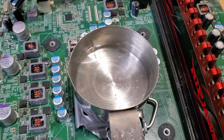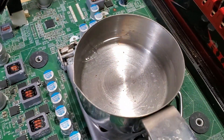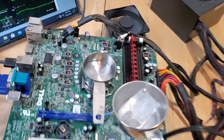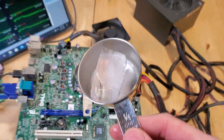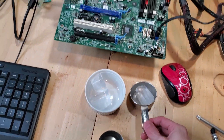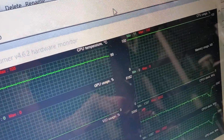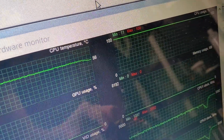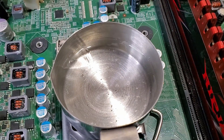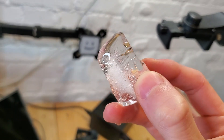After a couple minutes, the ice cube is basically gone altogether. With only a cup of water sitting on top of the processor, the temperature of the CPU slowly starts to climb again. Eventually this water will actually boil away, leaving behind an empty cup. So maybe what we need to do is simply replace the cup of ice every time it melts to sustain reasonable CPU temperatures — that's what they do in Futurama to keep the earth nice and cool. Grabbing a second metal cup, let's hot swap our ice to see if we can bring down the temperature with some fresh juice. With our replacement ice applied, we can see small improvements to the cooling of the processor, but overall it feels like it might be too little too late. It's safe to say that ice can in fact be used to cool off a processor in place of a CPU cooler, only if you're okay with a fraction of the actual cooling performance, and as long as you remember to replace the ice every couple minutes or so.